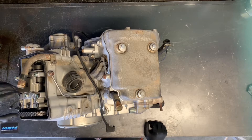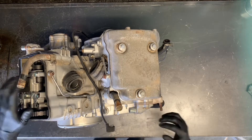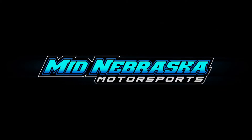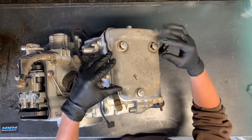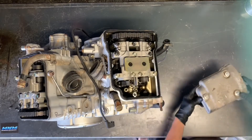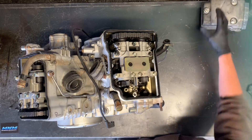We've shown a couple other videos on adjusting valves and stuff like that, so make sure you check those videos out — that is why we have this head cover off at this time. We're going to pull the front cylinder head cover off here. It is three 10-millimeter bolts that you've got to remove, and they're specialty bolts, so make sure you keep those in the right spot. I'm going to set the rear right on top and keep all those bolts together.